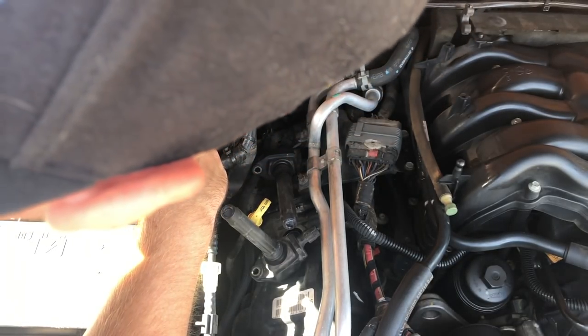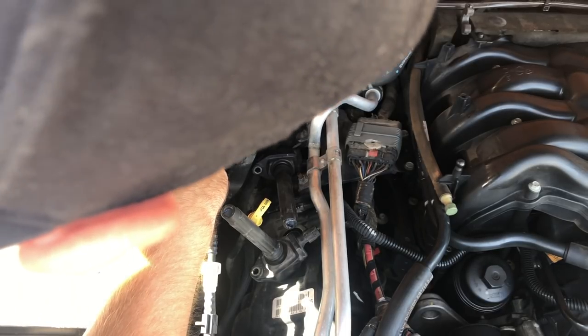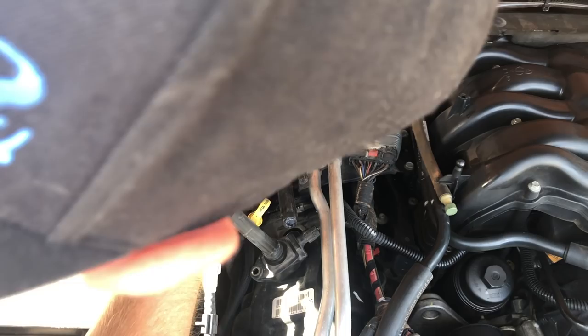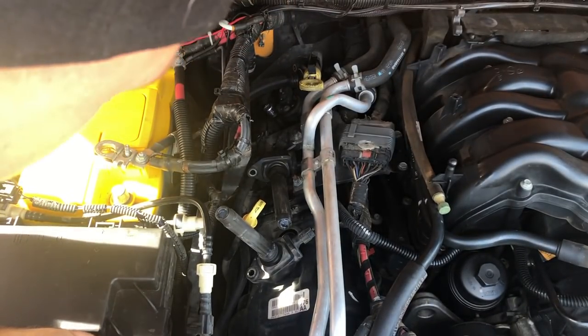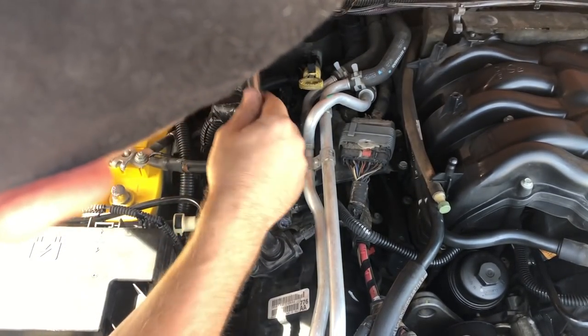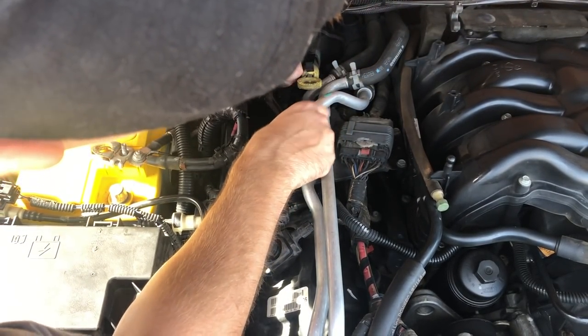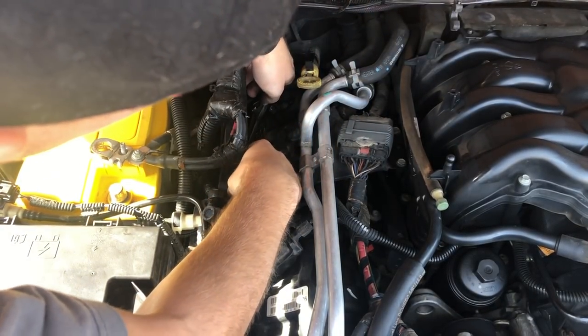It can lead to much bigger problems down the road, or immediately, if you strip your cylinder head or something. So be careful with it. All right, got that hand tight. We'll just give it like a quarter to a half turn more. Which, remember, this was click by click, so a quarter turn is going to be a few clicks. And that's as accurate as I can get.